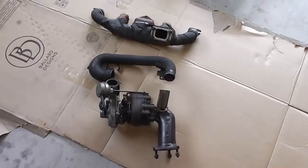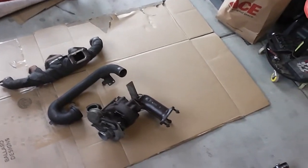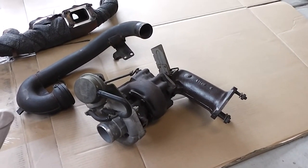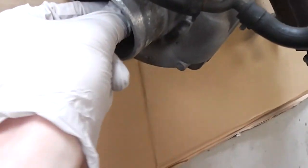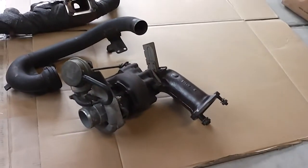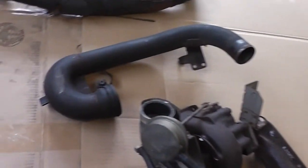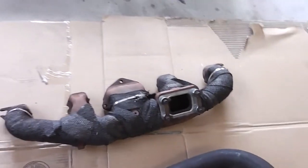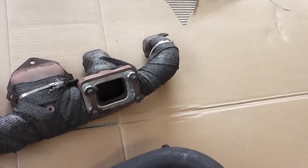I'll be using all factory Nissan turbo hardware. These are the major components: an original T3 turbocharger off a car that was wrecked in 1984 with about 21,000 miles on it. You can tell because there's pretty much no rust on the hot side of the exhaust and there's no shaft play on the turbine, though it is a little stiff — probably gummed up from old oil. I also have the downpipe elbow, the charge pipe from the turbocharger to the intake manifold, and a turbo manifold all heat wrapped and ready to go with new gaskets.